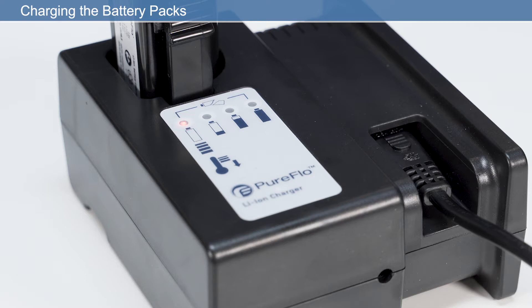or that the battery has failed. When LED 1 is solid red, the battery is charging. As the battery charges, LED 2, 3 and 4 will light sequentially solid green until fully charged. If LED 1 flashes red and LED 4 flashes green at the same time, the battery has failed.